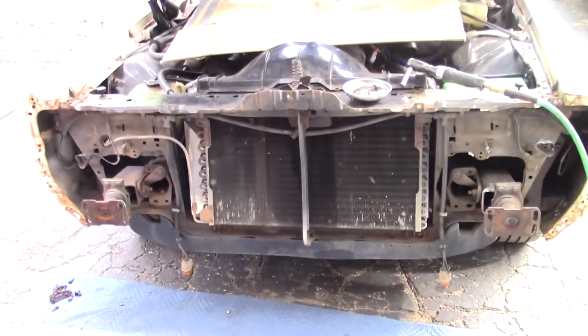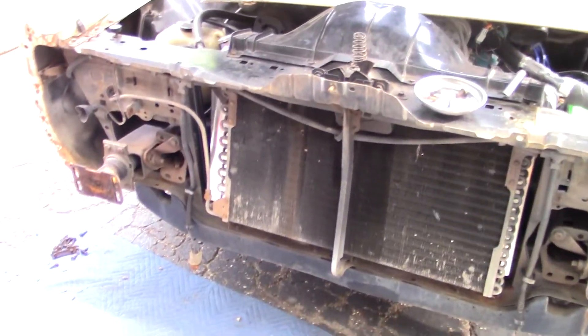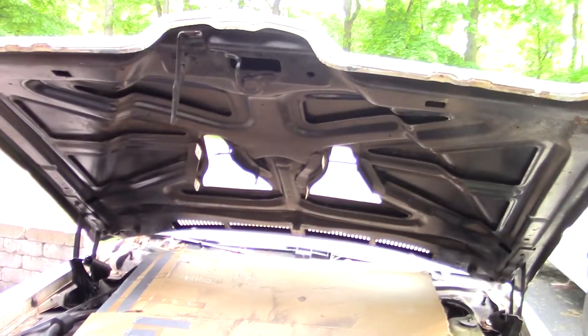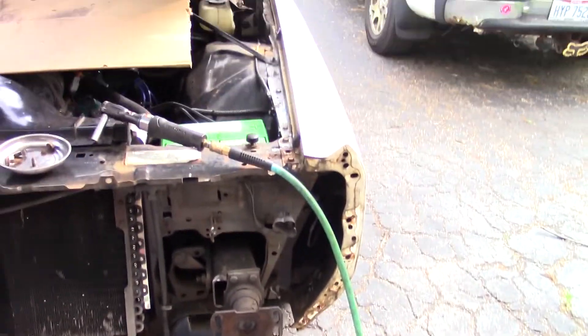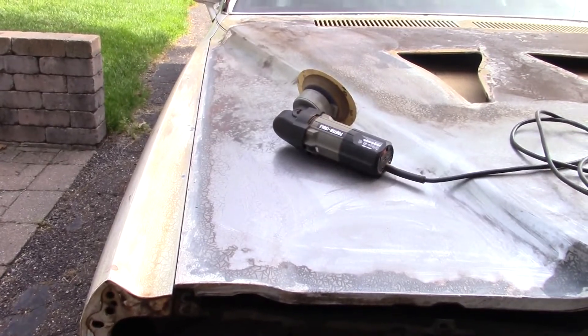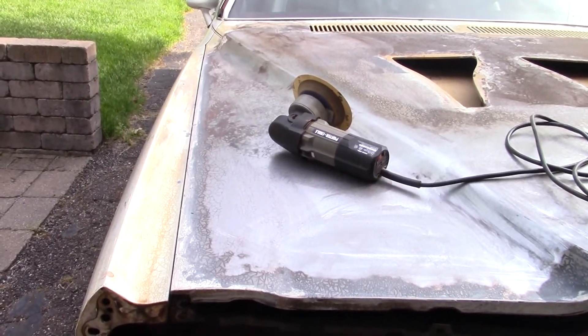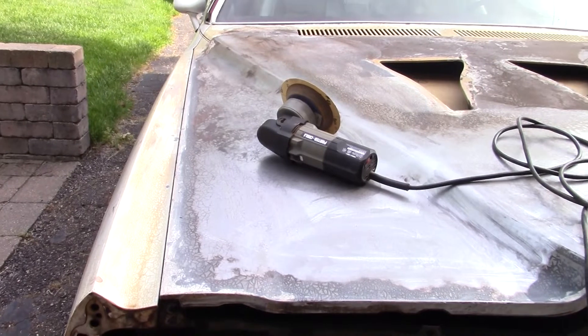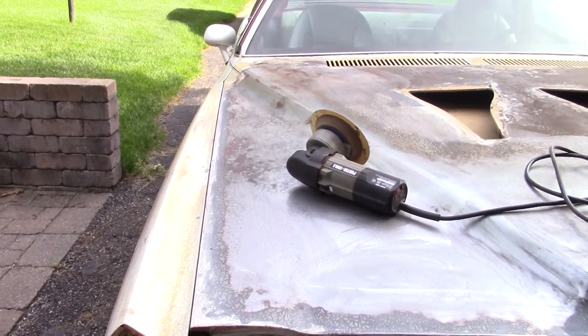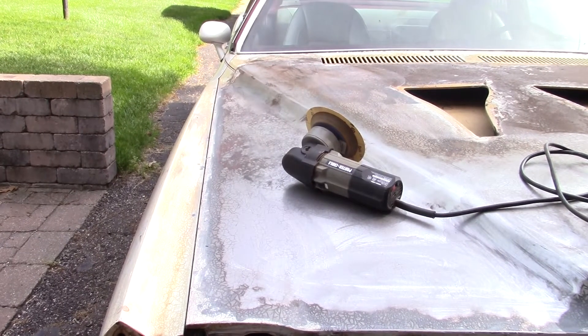I've got the nose piece off. I'm just going to do a little bit more paint removal around the hood scoops, and I'm going to start on the fenders a little bit. I got some slightly more aggressive sandpaper just for this one area because it's probably the worst area on the hood, and then I'm going to spray it with some rust killer — I've got a couple things actually, Rust-Oleum and something from Summit Racing. So just going to hit this one little area here and go from there.